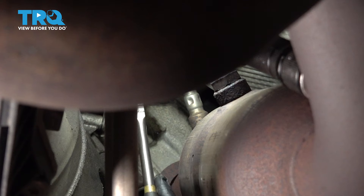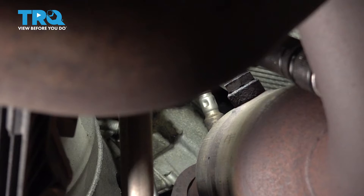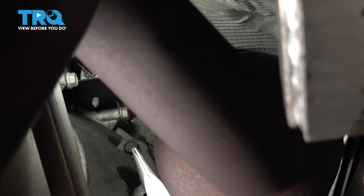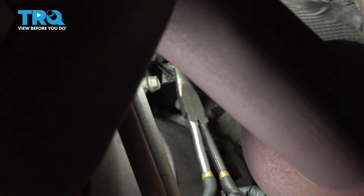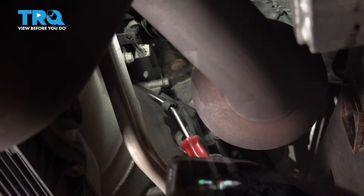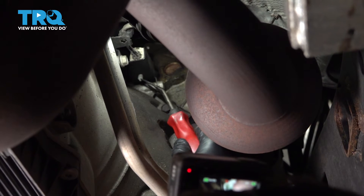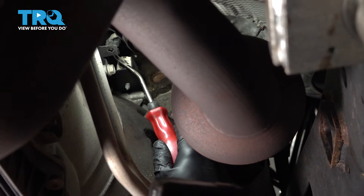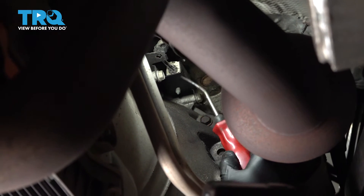What I'm going to try and do is disconnect this wiring harness first, and I'm going to use a pair of pliers here. I'm just going to press in on this little tab, or maybe pinch both sides of this here, and push this up and through. With that wire loose, we're going to go ahead and push this little Christmas tree clip up and out. That's going to release the harness up in the top, and then we'll go ahead and disconnect that connector there.